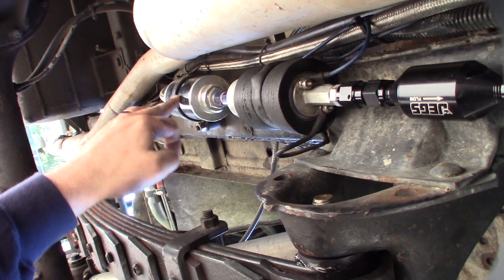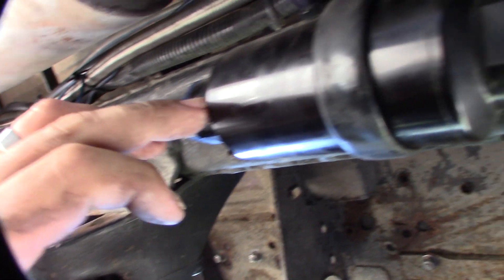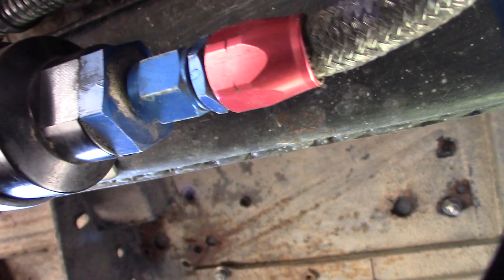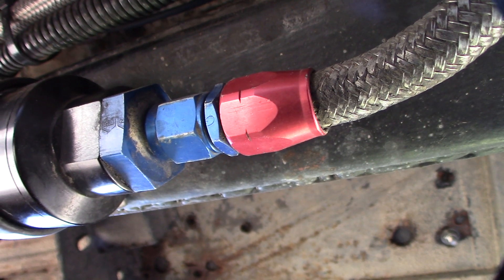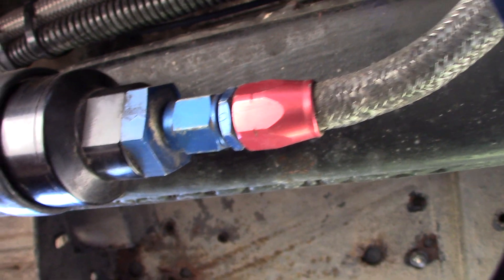Here's the setup: the pre-filter comes into the fuel pump, then this is the anti-drain back valve, and then it goes into the after-filter and up into the engine. It's a little close to the exhaust pipe but it's fine. Hopefully this will maintain pressure all the way forward. If I also have a leaking fuel injector, that could be causing a hydro-lock situation too.